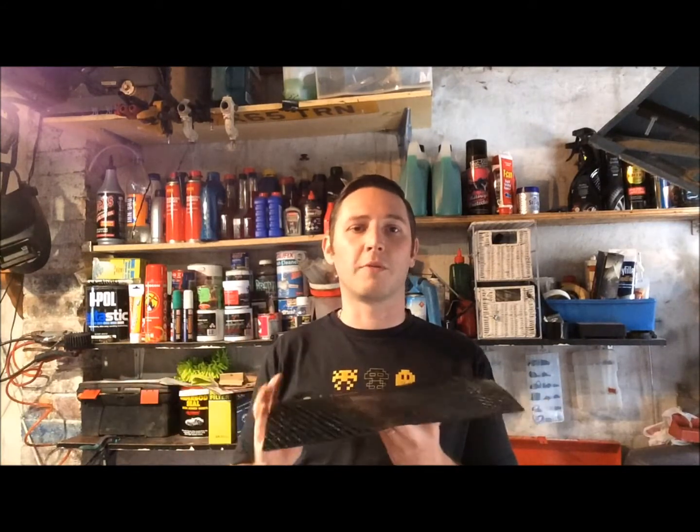Hi everyone and welcome back to another episode of Classic Mini Maintenance and Repairs. In this episode I'm going to show you how to install bitumen sound deadening sheets. This is quite an old school way to deal with sound deadening but I highly recommend it for your mini. As we all know minis leak, and unlike the foamed sound deadening, this won't hold on to the water and cause you further problems down the line with rotten floor panels and mould in your carpet.